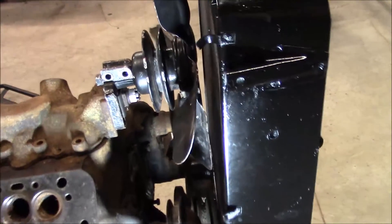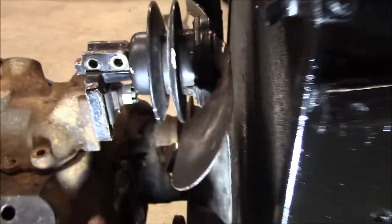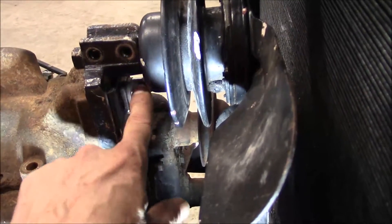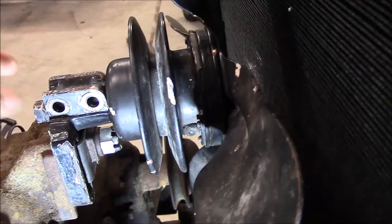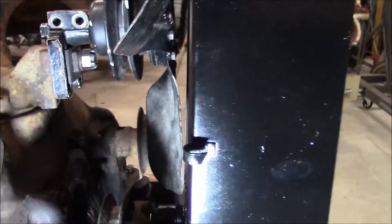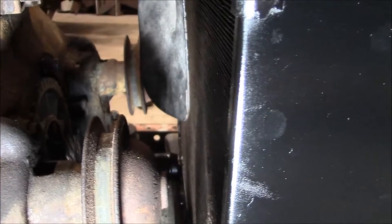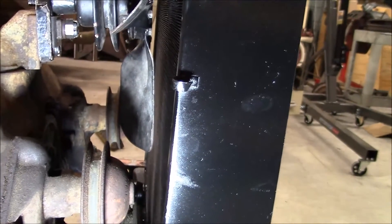I took off the fan and got the blades tracking correctly and evenly. I made myself a little U-bracket to mount the fan bracket to the intake, and I've got a new nut. I'm still going to have to re-groove the shaft since the grooves are now farther back, but I think the fan situation is squared away. I have about a quarter inch from the closest point of the fan to the radiator, which I think is about right, there's belt clearance, and the pulleys are lined up.